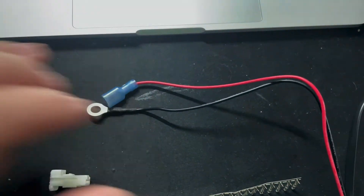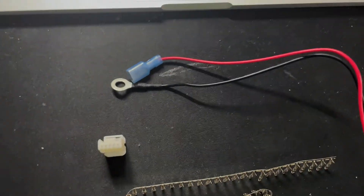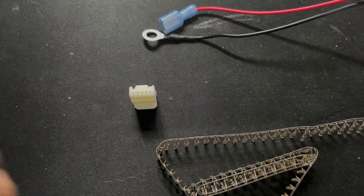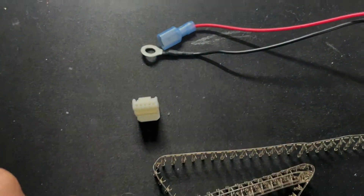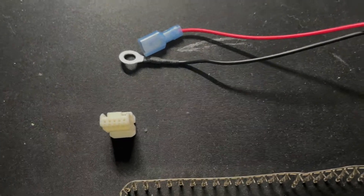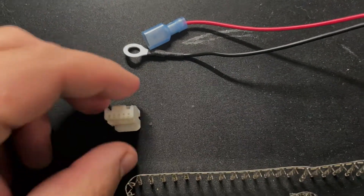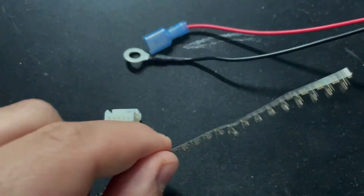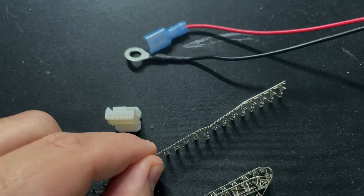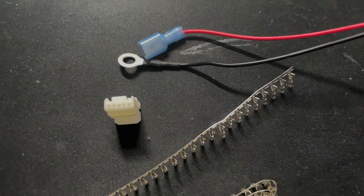We only need two pins. Here is the plug set. There are three pins in the headliner plug: one for ignition 12-volt, one for constant 12-volt, and one for ground. I'll show you which pins to use for ignition 12-volt, because I don't want to leave my radar detector running all the time. Let me clip these ends off and crimp these pins in and insert them into the plug.